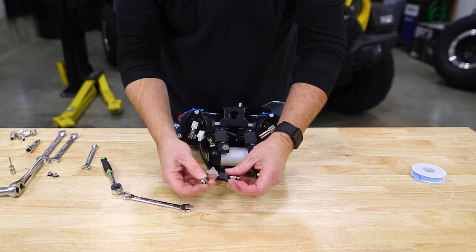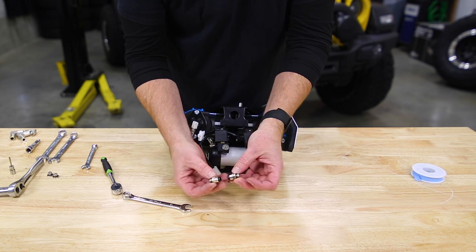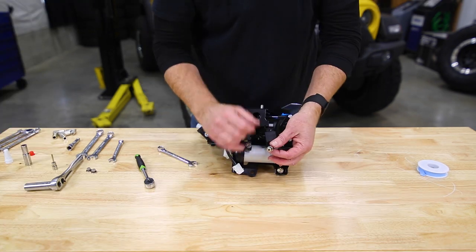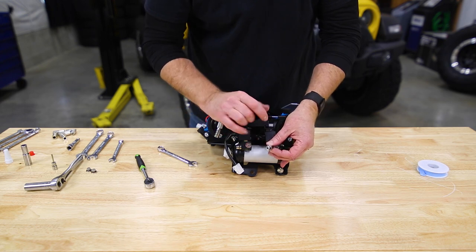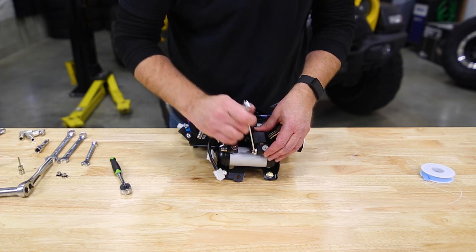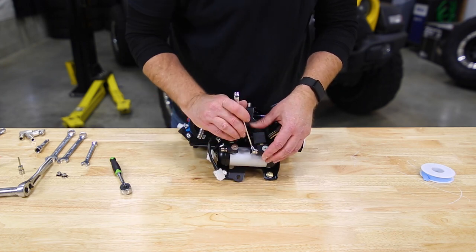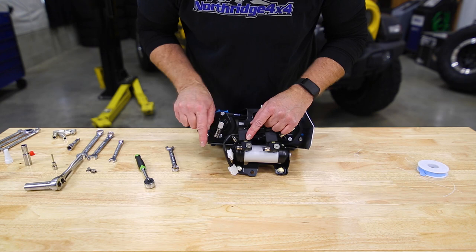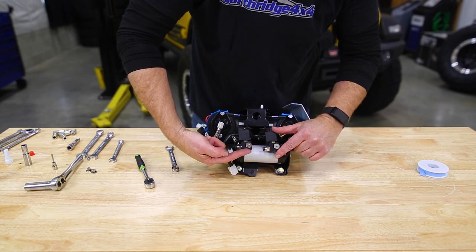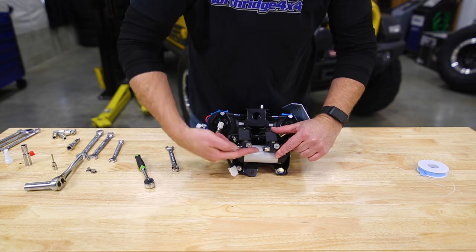And then we're gonna grab our 2 push-in fittings for the plastic lines, and they'll go into the solenoids. These ARB fittings have an O-ring on them, so you don't need to use any Teflon tape. You wanna have 1 coming out the side, and then this other one needs to be tipped back just enough so the plastic line can come down alongside and plug in.